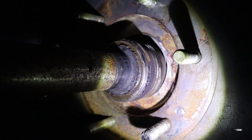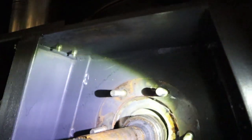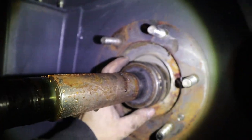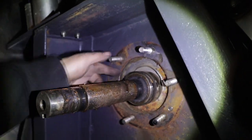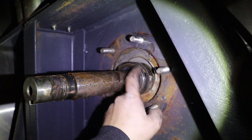This is where the little bearing sits right here. This is the sleeve — this is actually the shaft, and this is actually separate. Do you see how this is all jacked up and shiny? What you want to look for is grooves on that. If you can drag your fingernail across and feel grooves, that means it's been wearing hard — it'll wear out your seals. Your seal sits right on this sleeve. That's just where water gets in. All that will have to be cleaned off with emery cloth and sanded and polished a little bit.